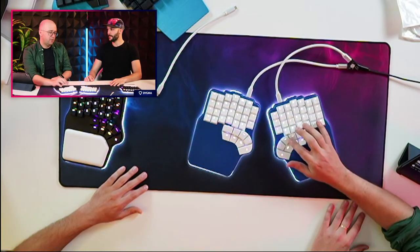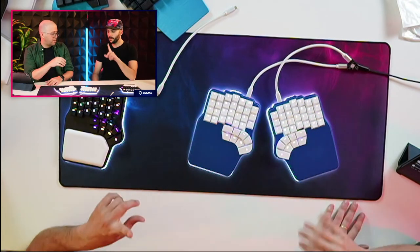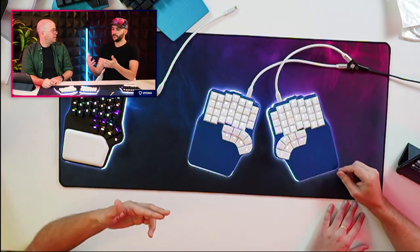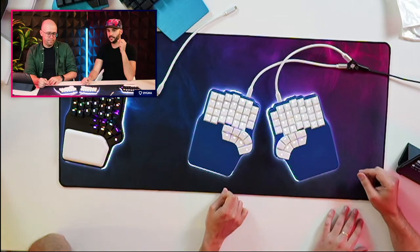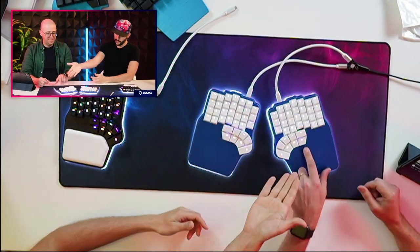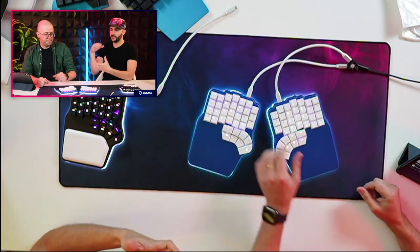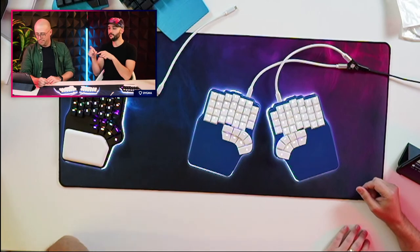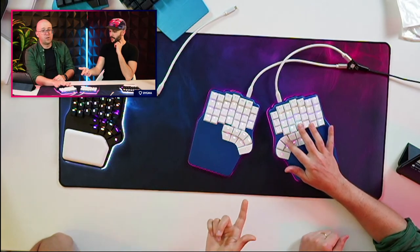And you can configure how fast the hold function triggers. And I've been using this keyboard, and there's no problem at all. Is that a dual function key? Yes, that's a dual function key. Okay, so a dual function key has a delay, because the keyboard has to recognize if you're holding it or tapping it. But this, for example, is move to layer, which is really fast. Oh, now I have a delay. No, but actually, you hit it and it's instant. Exactly. On the dual function keys, because the keyboard has to recognize what you're doing, until you press the next key you have a little delay, like you've seen. And you can configure that.